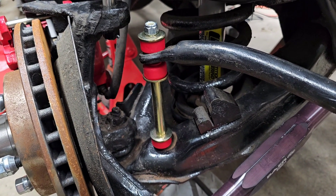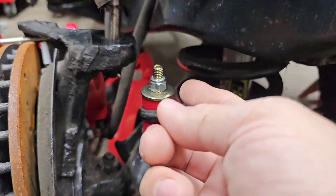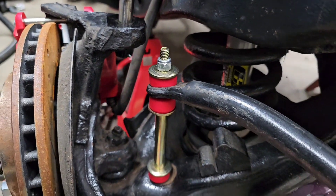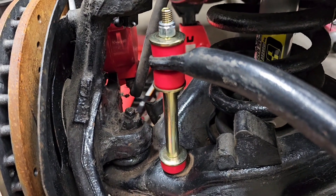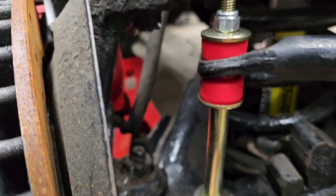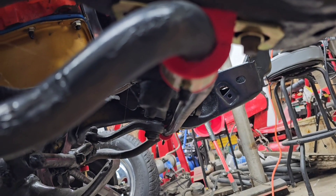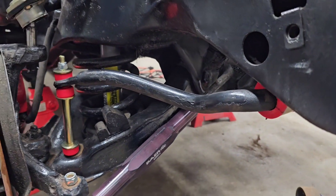Everything's tightened up. This is what we've got with the 8-inch bolt — as you can see, we now have significant threads on the bolt. If you remember the factory ones, the stud was actually even longer than this 8-inch bolt, and I don't know why they use such a thin rod. But this is a 3/8 bolt, so it's a little bit beefier. Should work out better, especially with these polyurethane bushings versus the rubber ones. And of course, you've got your bushing — it even has a greasable fitting here. We'll grease that up before taking this on the road. The other side looks the same, and that's what we have with the Energy Suspension kit.